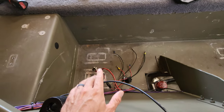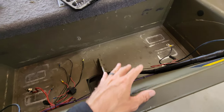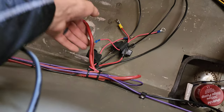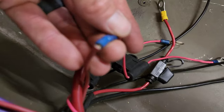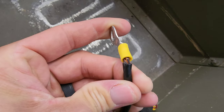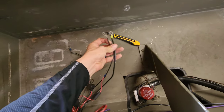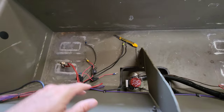All cleaned up. I'm going to go through the wire, clip the zip ties, get it organized, and start placing batteries in trays to figure out the layout. As I go through the wiring I'm checking everything — looking for splits and damage. Anything that needs to be redone, I'll cut and redo it. I may just go ahead and replace all the terminal connectors because even some of the existing ones don't look great. Got everything mocked up for install — it's going to be a tight fit with two batteries, two batteries, and the onboard charger snug between them.